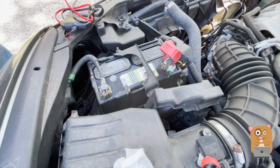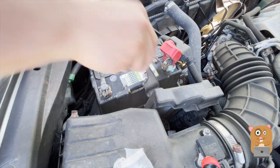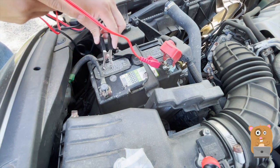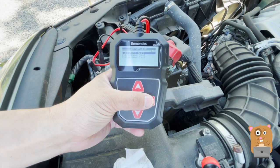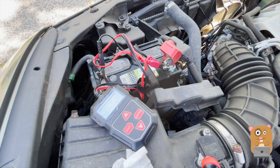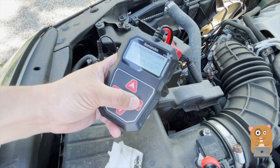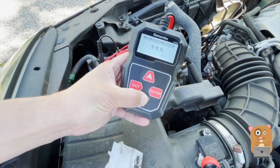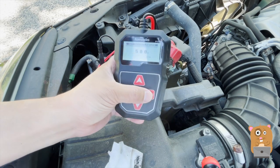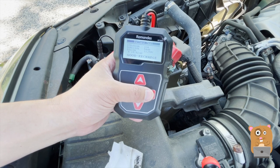Here's my Acura TSX — it's got a smaller size battery and the CCA on this one is 500. Let's do a check — in-vehicle battery test. Turn on the headlights. I'm going to do a regular flooded CCA of 500 this time. This is in good shape too.